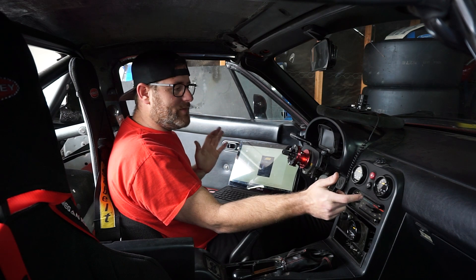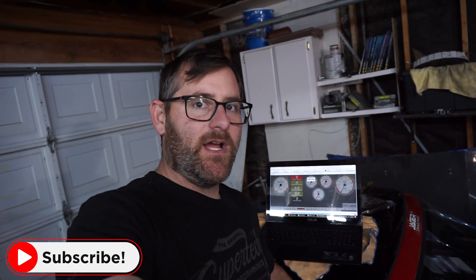Later on down the road I might change that, but at the moment I'm going to leave it the way it is. This took me an extra day to figure out — I was struggling highly to get the CAN broadcasted from the Megasquirt to the dash. All the AEM net stuff worked as it should have, so I was trying everything under the sun. Turns out the biggest thing I forgot to check was the firmware version on the ECU. My Megasquirt was on 3.3.1 or something like that — it has to be 3.4 before it will broadcast to a dash. Make sure your firmware is up to date. The actual install of the dash was relatively simple and easy. Wiring was simple and easy. Got a little frustrated, let it simmer overnight, thought about a couple things, and boom.